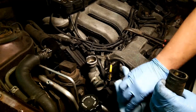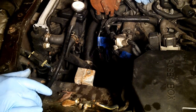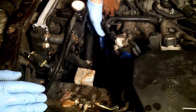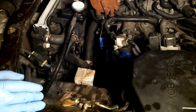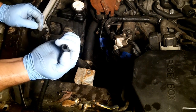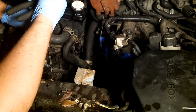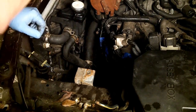This has got a lot of oxidation right here. We've got the upper radiator hose. Now we have to go get the lower radiator hose. The radiator hose on here is connected to the coolant rail — same as the four-cylinder except it goes down to the lower port for the radiator. It has this large tube that comes right off the bottom and tees into the lower radiator hose, and that is for air — any air bubbles will travel upwards and get caught in here. The easy thing to do is just disconnect this hose from right there, though these are the little unexpected things that end up taking 20-30 minutes longer than you thought, simply because a hose clamp is pointing in the wrong direction.